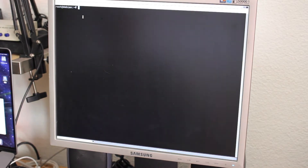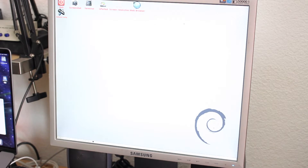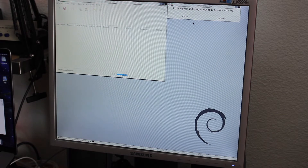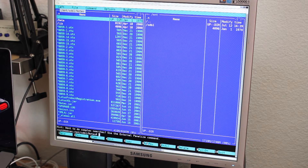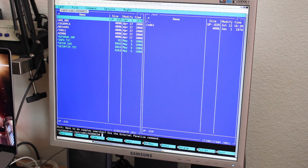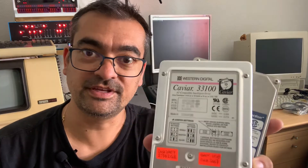But I'm too curious if the IBM drive still works or if it's dead as well. So I hooked up both drives using IDE-to-USB adapters to another machine and inspected them using Linux and GParted. It's now officially confirmed that the Toshiba hard drive is dead. The IBM drive, on the other hand, still works and I could navigate through the file system. I'm not so much interested in what's on there, except if just by coincidence there was maybe still an OEM directory containing setup and driver files. And do you remember those salvaged hard drives? Now is the time and day to look at them.